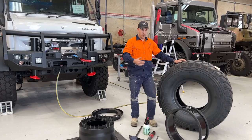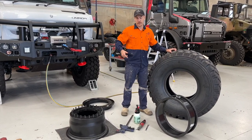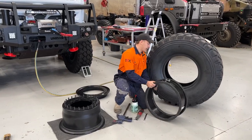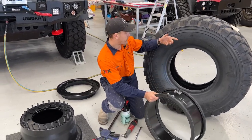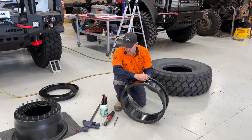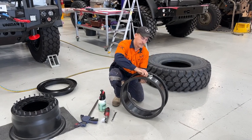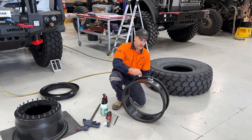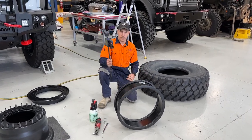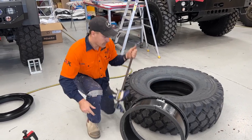You've got your new tyre and your new beadlock — everything's nice and clean. If you're in the bush and it's dirty, you want to give everything a clean out because that's going to be in there for the rest of its life or until you undo it again. You've got your beadlock and you've got to get it into the tyre — that's going to be quite difficult how it sits right now, so put it on the ground. Got your beadlock and your screws — take them off just one side, not both sides, and put them somewhere safe, otherwise you're having a bad day. Everything comes apart and it's going to move more easily now. This is where the clamp comes in. You can see the width of the beadlock compared to the bead inside — it's quite a bit bigger, and that's the idea: it's going to be clamping down.